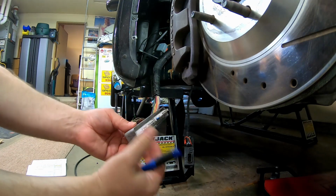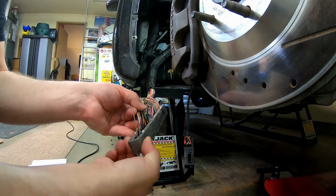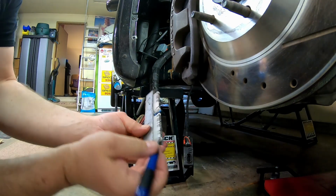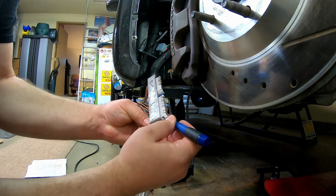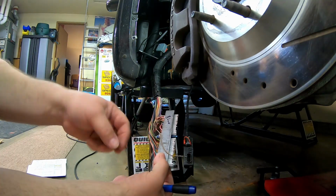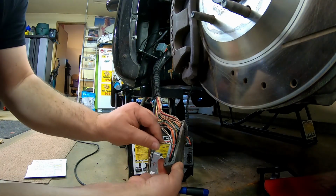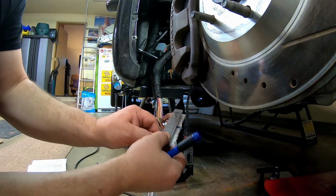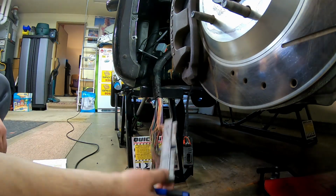So to release a wire, I'm going to release this one and then probably plug it right back in. But just for demonstration purposes, we're going to lift up just like that. And there you go. So you can see how that came out of there. Go ahead and stab it back in for temporary. You can see it coming through there, and then click, lock in.